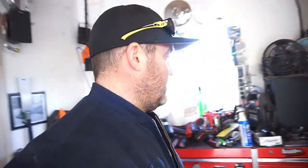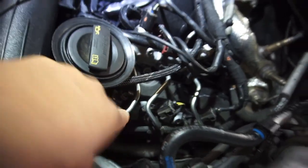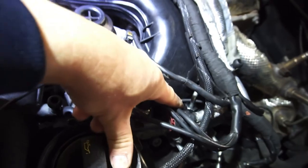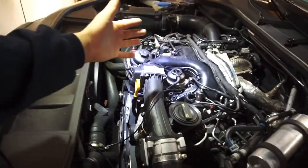I'll keep you guys updated on if I find anything more, or if it leaks again, then I know it's the front cover piece and we'll go from there. I thought the injector seals were leaking but they're actually not — I was getting some leaking right in here but the injectors are way down there, so I don't know why I thought injectors were leaking. I'm thinking it's this crossover tube that goes from one common rail to the other common rail.